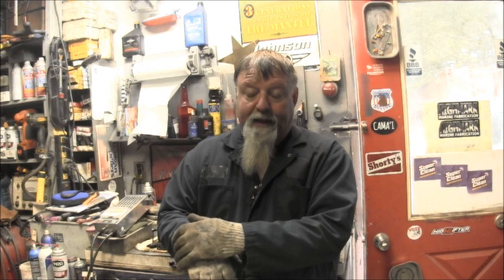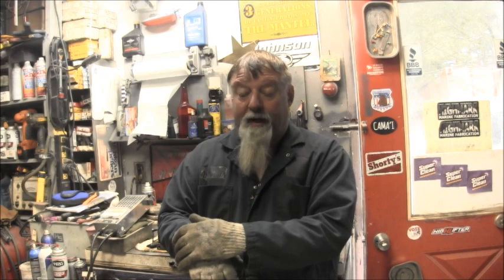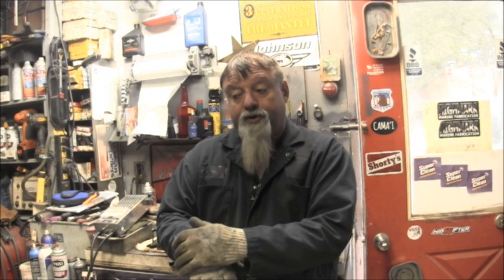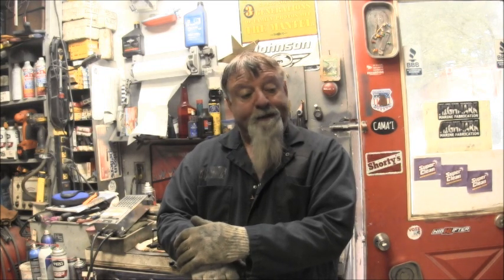I suspect with that broken lower motor mount, and this motor is used in a commercial capacity, I told him that it probably just vibrated with that lower mount broke, and the upper mounts were pretty weak anyway. I told him it probably just shook so much that the power head bolt started to come loose. So the motor seems to run fine, other than some smoke coming up in the engine compartment. So I told him for this particular trip they're going on, he's going to use it, he said, about 4 times to run people to a dock and back out to the big fishing boat.